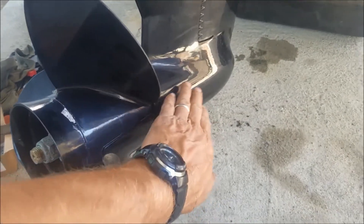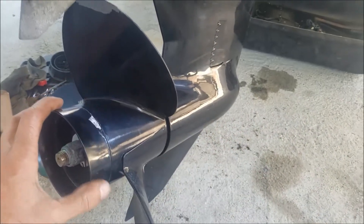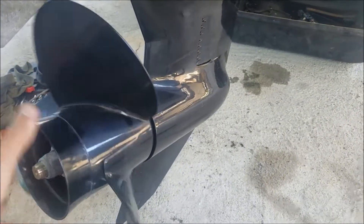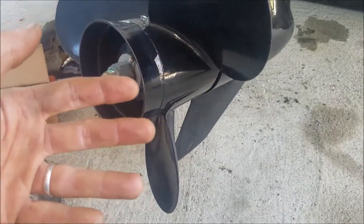I'm gonna demonstrate the rattling for you. We're gonna stop kind of half in gear and show you what you don't want. Just go slowly forward. There — you hear that? It's doing that. That is very bad. That means that the gear teeth are just touching the tops of the teeth instead of being fully engaged.